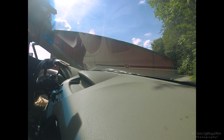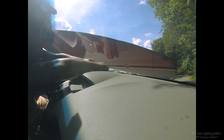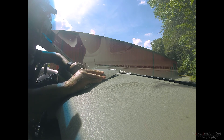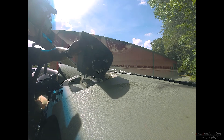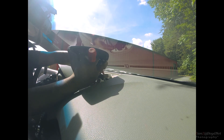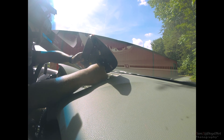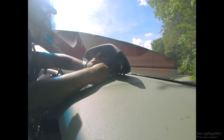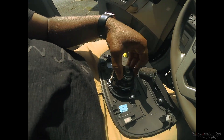Now I'm ready to tackle the center channel. It's pretty easy to get to — I couldn't find it on YouTube anywhere, but basically you stick something right here, lift it up, and lift out these two clips in the back, and it just comes right out. The main thing is those clips in the back — you go to the back and pry it forward, and the rest pops right out. It has two screws, runs at 15 watts, and it's a 4-ohm driver, so we shouldn't notice any difference in sound from this position.